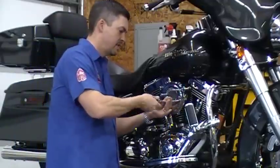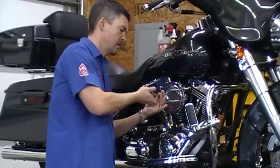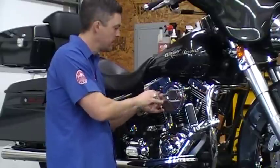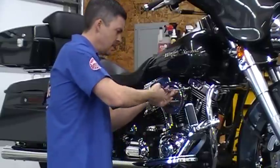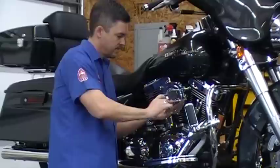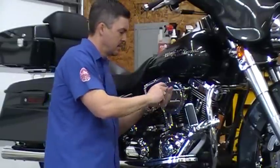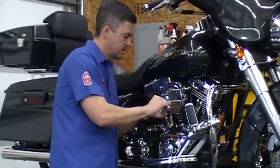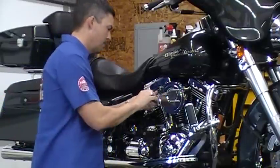It's best to let this stuff sit overnight on a cold engine — Loctite. I like small tools, small wrenches. You do not want to get carried away with a billet piece of hardware. They're fragile — they can break easy. So when we install them here at Cycle Solutions, we use small tools, not very big ones. Pretty easy to break.